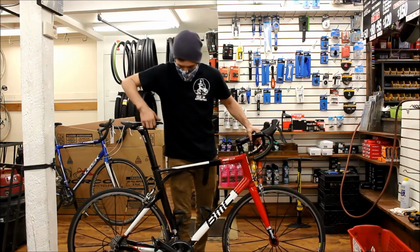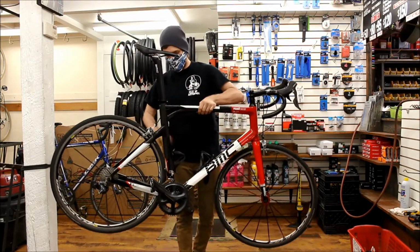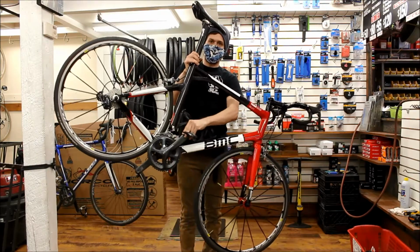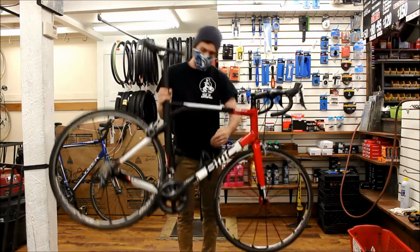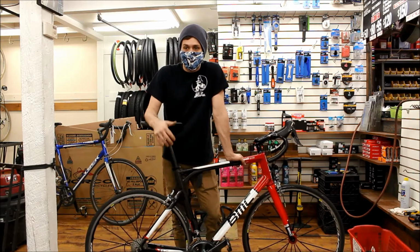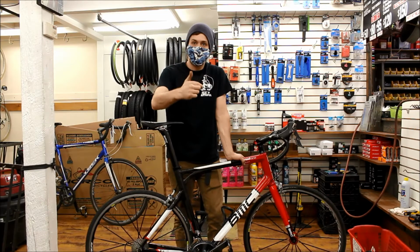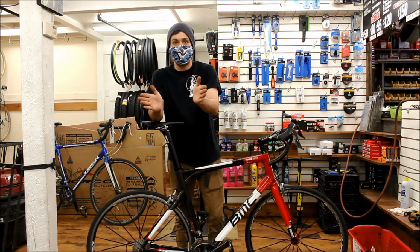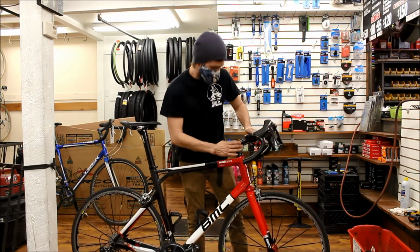Down from this tip of the M to the cranks, here you're doing basically the same thing as at the rear wheel, just at the crank area. So you're gonna shake it side to side, look for play, you're gonna give it a spin, make sure everything's nice and straight. This bike doesn't have a chain on it at the moment, but yours probably will. So give it a little bit of a spin, look at each link, make sure there's nothing bent or twisted or, you know, splayed open or anything like that. And then move from the lower point of the M to this tip.